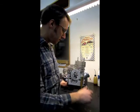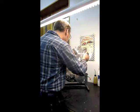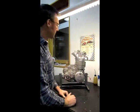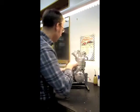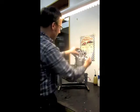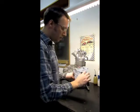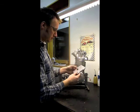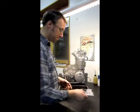It's working like this — let's put it on and see how it looks. There you go. You might pay a little bit more attention to the cam timing than I did this time. You have the cover on top, and on the other side on the cam chain tunnel is this lid. There is also a hall effect sensor here that makes the ignition and the fuel injection work only when needed, not on every turn.